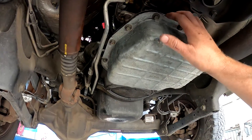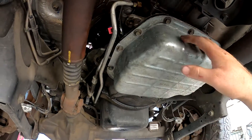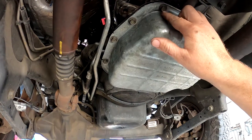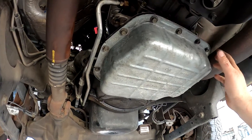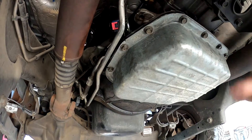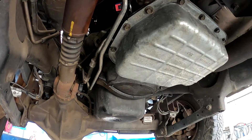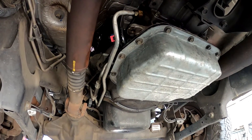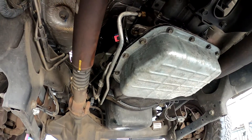Transmission pan's cleaned, new gasket's down, pan gasket's torqued. I like to gun them on really lightly, let it sit for a second, and then go around the perimeter and torque them. The torque for these transmission pan bolts is 125 inch-pounds. The connector's back plugged in and it's as cleaned out as I can get it. I'll lower the truck down, put ATF Plus Four in it, and drive it. Hopefully there won't be any more leaks, but I'll check it after an extensive test drive. If you made it through to the end of the video, appreciate you watching, and I'll see you in the next one.